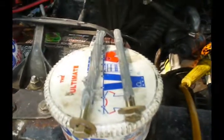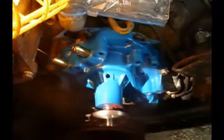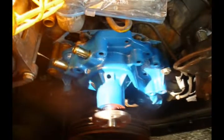Alright, put those 2 bolts in, this one here and this one here. Here's the next 2 to go in. All anti-seized up, ready to go. Notice they're not flange bolts. Flange bolts break. I can't find any replacements. I'm putting regular cap screws in there with washers on them.